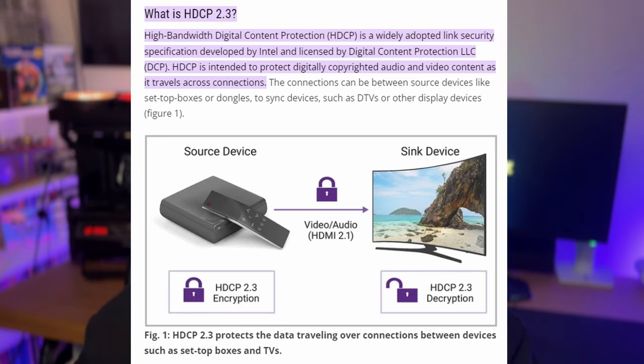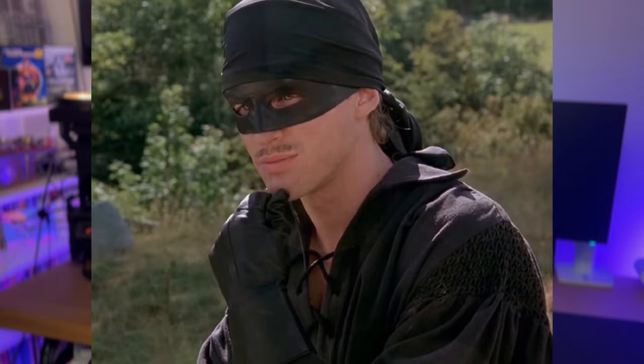If you want a productivity monitor, there are so many other options for $830. I saw that it had HDCP 2.3 capability — HDCP is High Bandwidth Digital Content Protection, a widely adopted link security specification developed by Intel. I got super excited because I thought you'd need HDMI 2.1 to have that, but alas — you can have HDCP 2.3 and still have HDMI 2.0. I was so excited to do a custom resolution at 499 hertz with no Display Stream Compression and get that incredible benefit you actually get with HDMI 2.1 if you have a 40-series card. Unfortunately, HDMI 2.1 is not here. As we learn from The Princess Bride, we have to get used to disappointment.